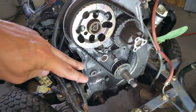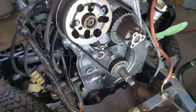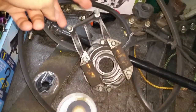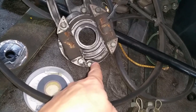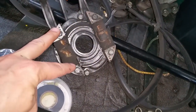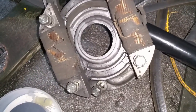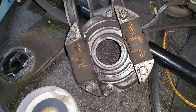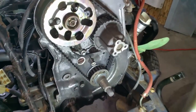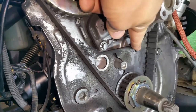Once you get to this point, removing the flywheel exposes the bracket that holds the ignition coil on top of the flywheel and then the charging coils which are mounted on the inside of the flywheel on the same bracket. The ignition coil will mount here — one, two, and three bolts hold that on — and then these two bolts hold the two charging coils. I already have a pretty bad problem here: looks like the insulation on these charging coils has broken down. Obviously we cannot leave these charging coils in this state and will have to replace them.